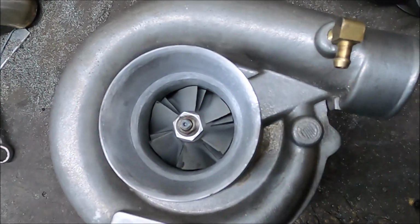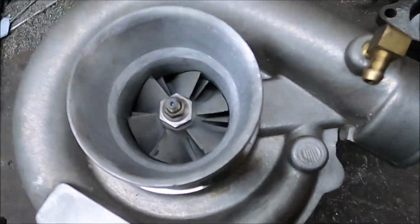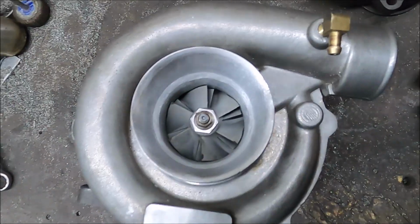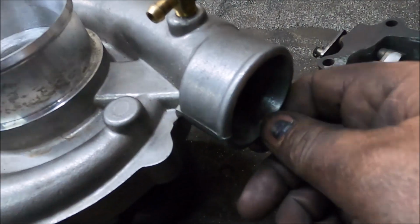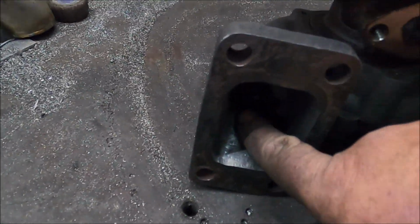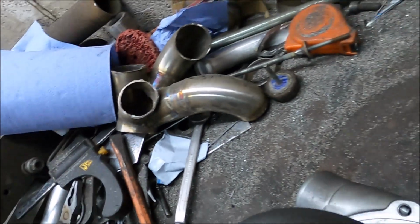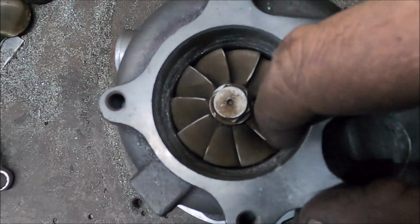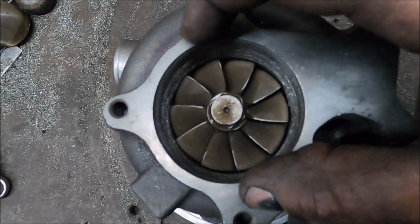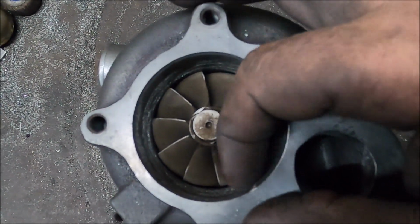And this is one last look at the ported eBay turbo. A much better inlet, proper bell mouth all the way in, smooth outlet, port matched inlet, and on the turbine side, nice, it gets big from the turbine wheel instantly rather than a thin step.